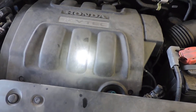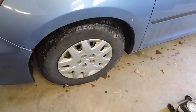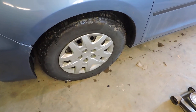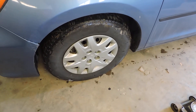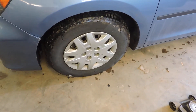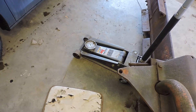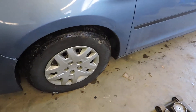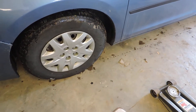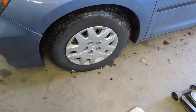The other thing I'm going to do today is a tire rotation — moving the front tires to the back and the backs to the front. This manages tire wear better. With a front-wheel drive car the front tires wear a whole lot faster than the rear tires. I typically did that every other oil change with conventional oil, so twice a year, and I'm due on this one. I'll use my floor jack on the front and a smaller floor jack on the rear, lifting two wheels at a time. I also have an impact wrench with an air compressor, so it won't be difficult.